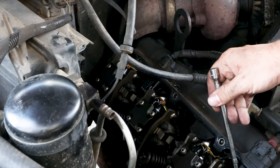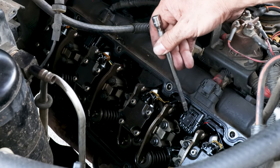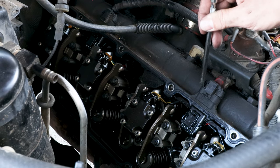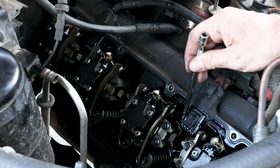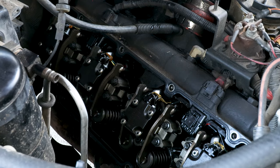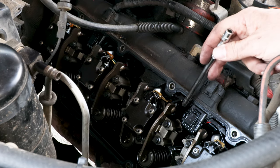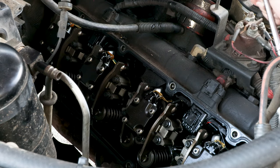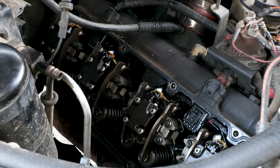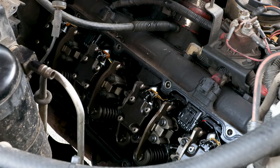You can see where the glow plugs have burnt this part of the harness right here on the inside. Most of the time it's on the truck side of the plug that burns, but this one is actually burnt on the inside of the harness. This harness really should be replaced. Since it's a spare truck, we're not going to replace it unless we have to — but we might find that the burnt harness is actually the problem. If that's the case, we'll replace the harness instead of an injector. We're fixing to find out.